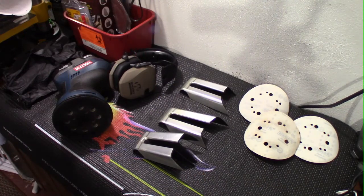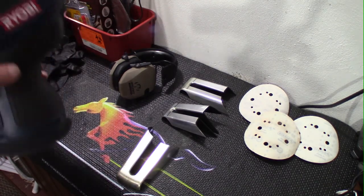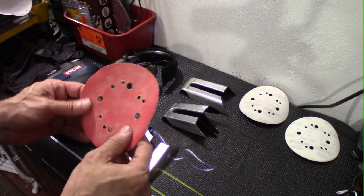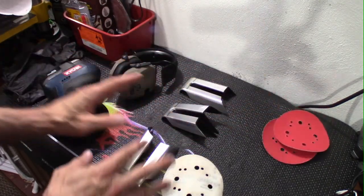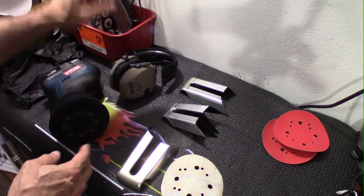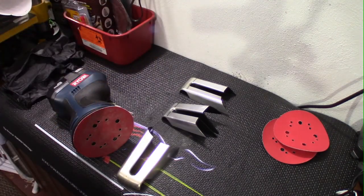Now it's time to start working on these pieces. I'm going to work on the most severe one first and go a little more aggressive — I've got my electric orbital sander. I'll start at 60 grit, which is slightly used, then move to 100 grit and then 150. If the results are satisfactory I'll take it all the way down to fine grit. I'm putting on my hearing protection, turning off the microphone, and we're going to get at it.